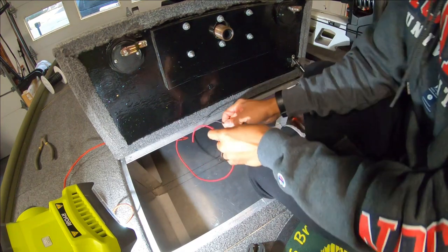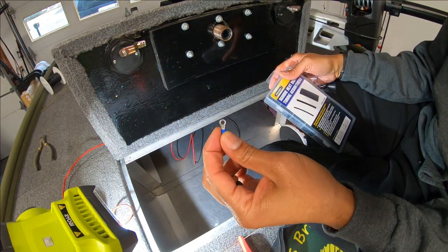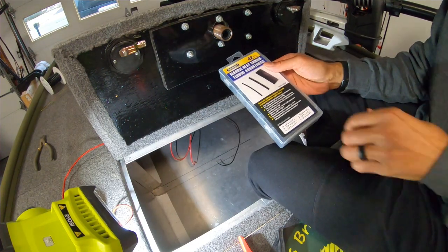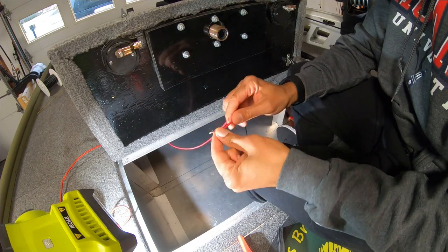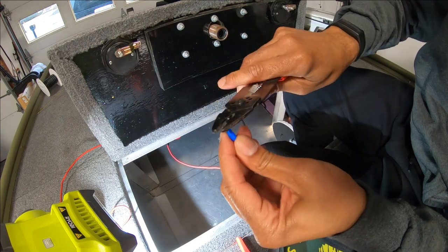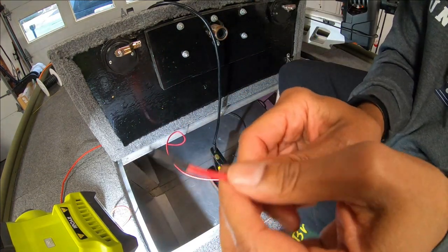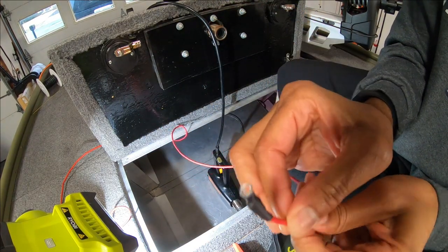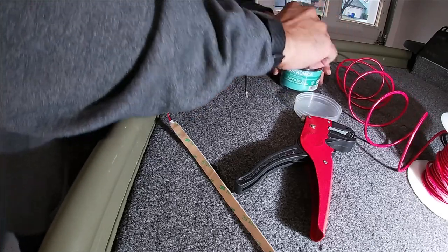I have my positive and negative leads from the left LED strips and I'm going to put some ring terminals on them. I'm using number eight ring terminals — rings because they're a circle and they don't pop off once you screw them in. I also have some marine shrink tubing from Harbor Freight; these have sealant inside. Make sure you put your shrink tubing on first, get your terminal pushed through, crimp it down, give it a couple tugs to make sure it's on there good, slide your tubing up and heat it so it shrinks down. You can actually see the sealant oozing out to create a watertight seal. Everything I'm using in this video will be linked in the description below.